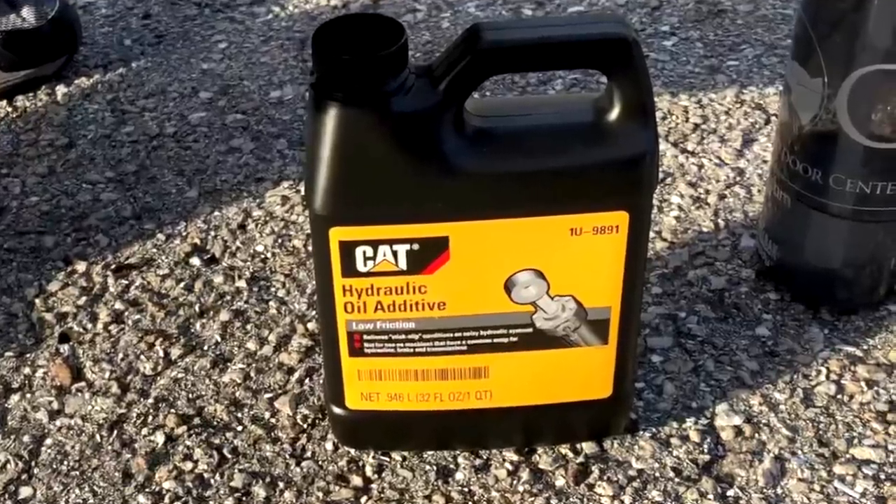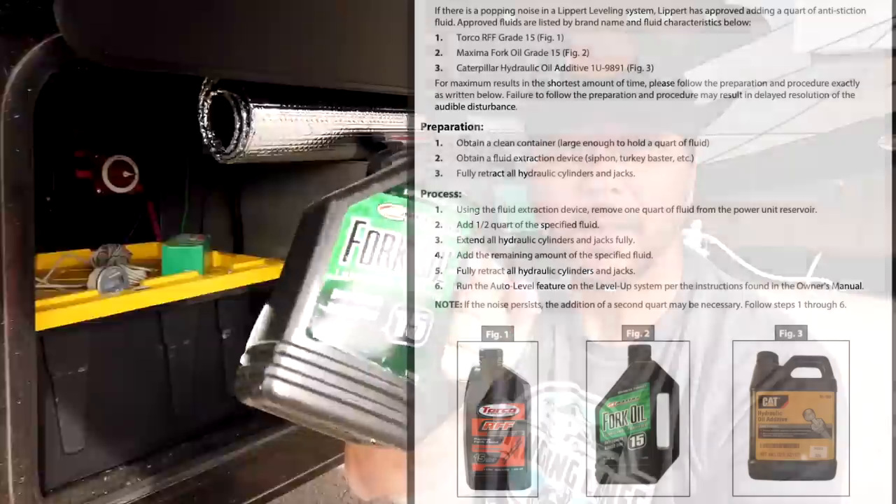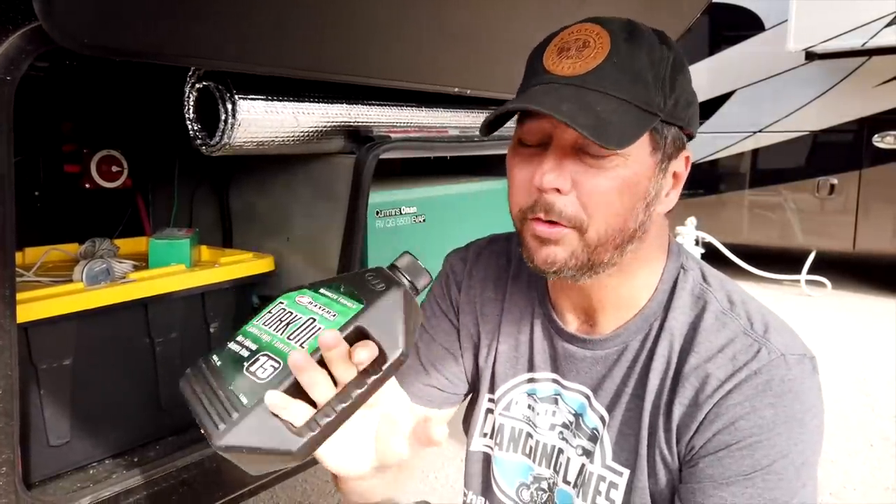All you have to do to remedy this situation is pull out a quart of hydraulic fluid and put in a quart of what's called anti-stiction fluid — sometimes it's called hydraulic fluid treatment. I'll put a link below to the three types that LCI recommends; this is one of the recommended treatments and there are two others. Basically it's some kind of treatment for the hydraulic fluid that makes it so it doesn't slip and pop and do that funky thing.